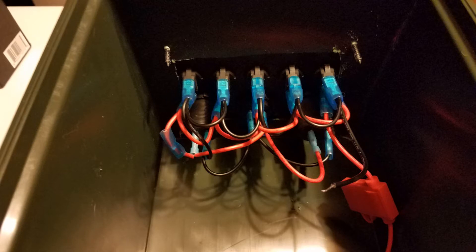This panel was wired with one hot end and one ground and jumpers to the 5 switches and the 3 accessory ports. I wanted the furthest left switch to be a main power switch, and that was pretty simple — all I had to do was flip the jumpers around. The problem was the main power lead and the main ground were on the right furthest switch, so I ended up taking the whole thing apart and wiring it to my personal configuration. The panel does look kind of cool but next time I will go all individual components.